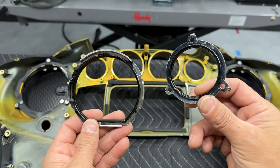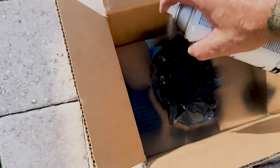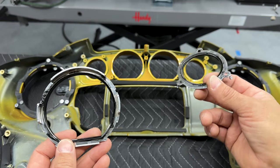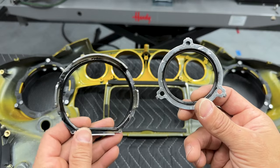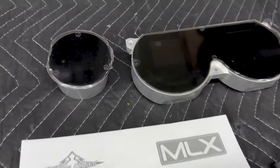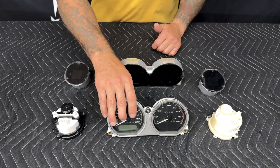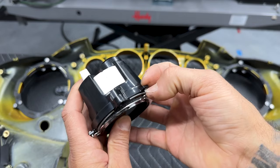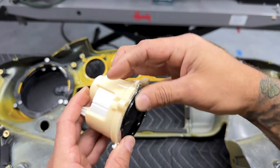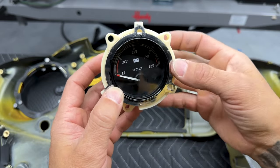I have the bezels all painted up — I just sanded them down, got all the chrome off to a rough finish, then added primer, gloss black spray paint, and clear coat. You don't have to spray paint the whole thing — I wouldn't advise it because you want it to sit flush on the inner fairing when mounting. Just spray paint the parts you can actually see. I'll mount these back on the gauges. I will be taking these off again to install Dakota Digital gauges, but I want to show that in a different process that doesn't involve taking apart the whole inner fairing — they just click right into place. Be careful with these tabs as they break very easily. Even with one broken, the three screws will hold it down firmly. All these bezels have a rubber pad on the back — put the bezels in first and then mount your gauge cluster.